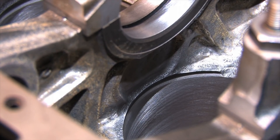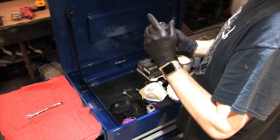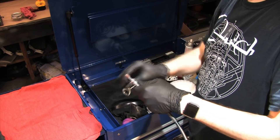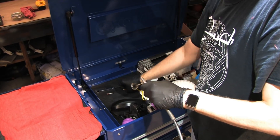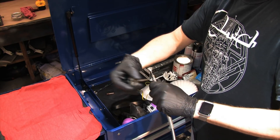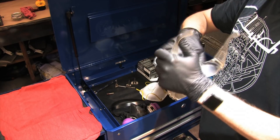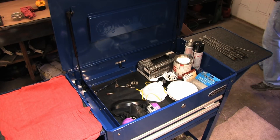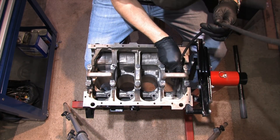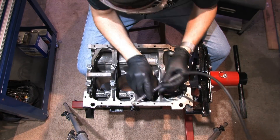Time to glove up and set up because all of the heavy grinding is done and the crankcase casting lines and imperfections have been removed. All I'm going to do is wire wheel down all the surfaces where my coating will be applied or where I see surface rust. These are just steel Harbor Freight rotary wire wheels sold as a five-pack for super cheap. I might use two dollars worth of materials on this, but you're about to see three hours go by in a flash. So with my crusty old safety glasses on, it's time to scuff the surface and get started. I start with a small cup brush to detail the extremities and then tackle the large areas with the larger cup brush.